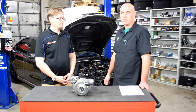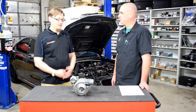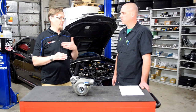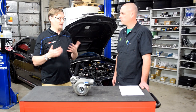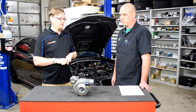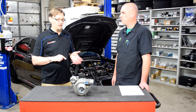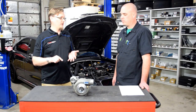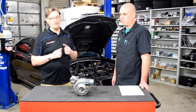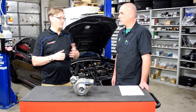Obviously the cooling on the front mount is a little bit better, so it's a trade-off. The interesting thing when the car was on the dyno is it was definitely making a lot more torque as we were adding boost pressure, and we had to kind of stop because we were on 91 octane — just pump gas and fully stock internals. What was most impressive about this turbo is it really seemed like if it had gone back with a forged bottom end, upgraded head studs, and maybe E85 instead of pump gas, there's even more potential in this turbo because of how much happier the car was to take more boost pressure and more timing.